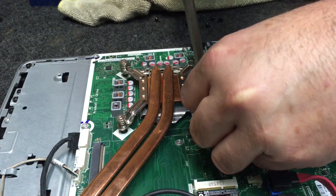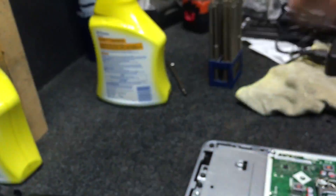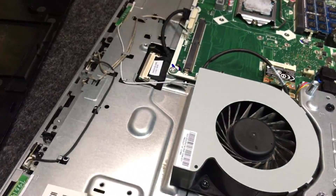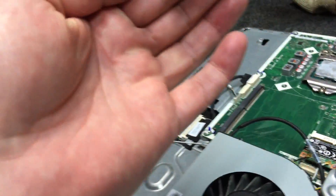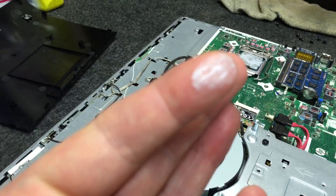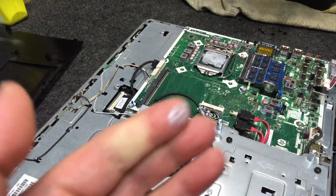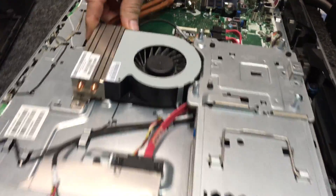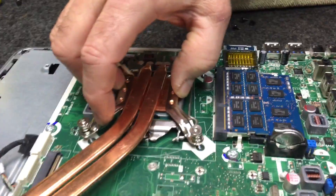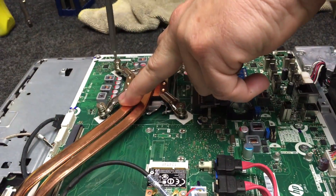The cooler sits right on the processor. Holy smokes. So you just blow it off or suck it up — just blow it out, because this is the fan and you gotta blow all that dust out. The sand blows right into it. And look at that processor right there — they put thermal gel on it so it doesn't cause static, so it doesn't touch. See, it's on there like that. Pretty cool. Then you just take it and it sits right back in there — it goes in only one way. The screws are spring-loaded, they just sit into the slots. There you go, and then you just put them back on.